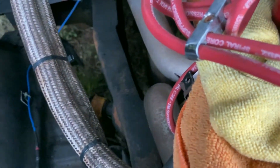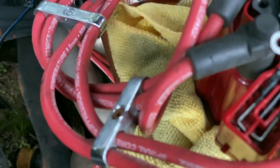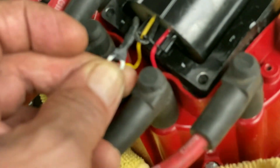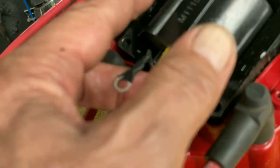Another workmanship and materials malfunction showed up here too. This is the ground lug right here for the distributor — this grounds the coil. Whoever did the heat shrink on this wire also took it halfway across the terminal. So that's additionally causing a problem with this distributor's coil finding ground. Unbelievable.